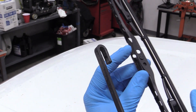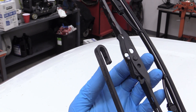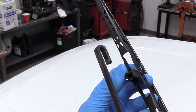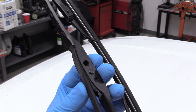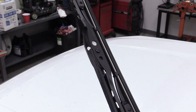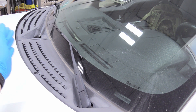All right, here's our new windshield wiper. It's 22 inches. I will leave a link down below in the description to it. We can see that safety we defeated earlier on it, so we just need to lay it down in its position. The cool part about this is it's really easy to get on — you just slide it like that. Make sure it doesn't go anywhere, give it a couple jiggles, and that's it. Then we can just lower it down into position and you're all done.